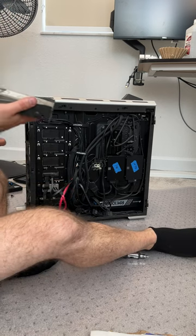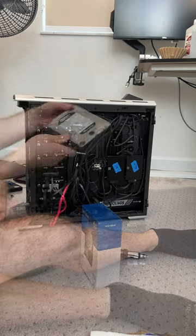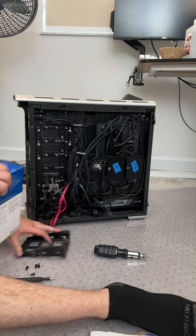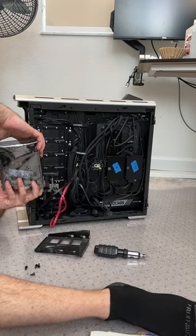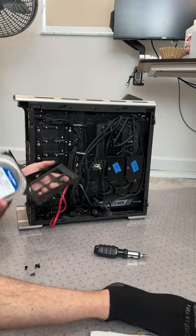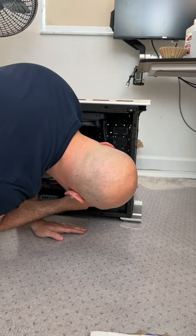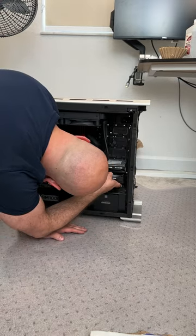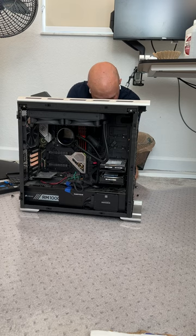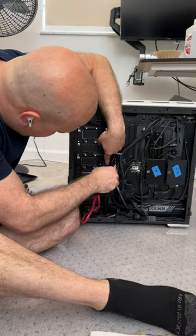I succeed and there's the drive — a little dusty, but it works just fine. I was really hoping to pick up an 8TB drive, but they didn't have them in stock at Micro Center, so I went with the 6TB instead. Once it's screwed in, I just have to secure it inside the case, then secure it with the thumb screws and reconnect SATA. Which is actually something I forgot to do in this video — it wasn't until about a day or two later when I realized I wasn't seeing the 6TB drive, so I had to figure out the problem, plug it back in, and then it worked. The 6TB drive is now storing project files.